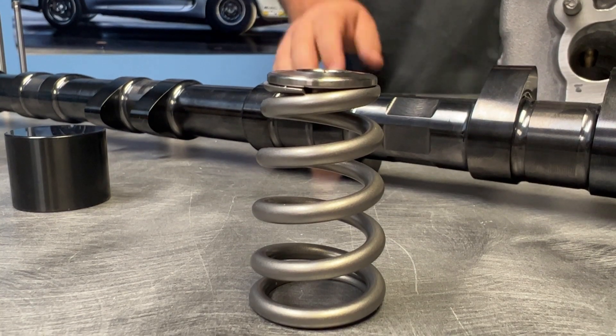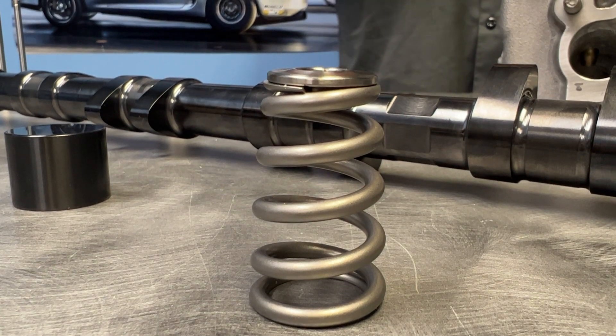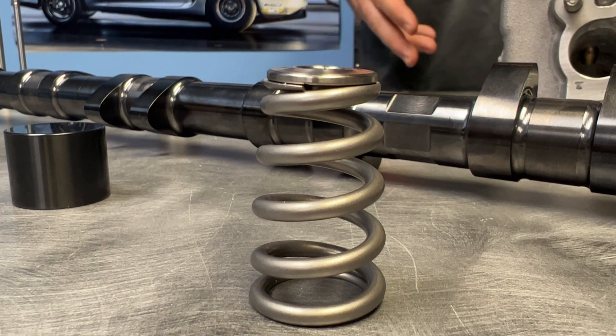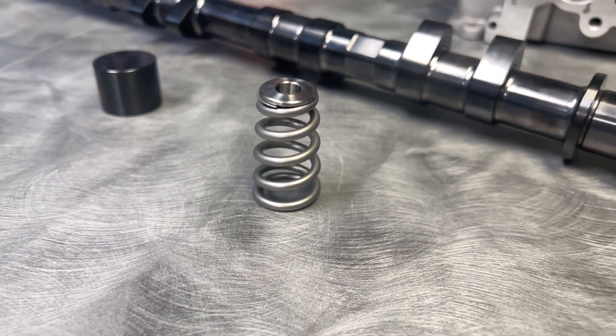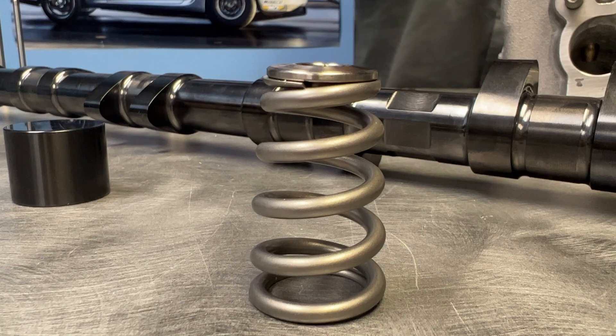We love the conical spring. It offers control, weight savings, and comes in three different varieties. Depending on how much power you're making, you can use just one spring and don't have to worry about fitting a dual in something that came with a single. GSC originally made these springs for Head Games, but now they're going to be readily available for everybody. We've been using them for three years and they've proven themselves to be the most reliable, best spring on the market in my opinion — and we haven't had any comebacks since we switched to this spring and bucket setup.